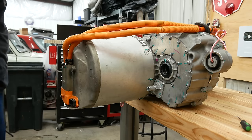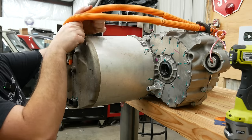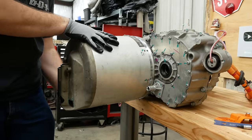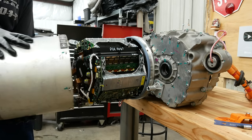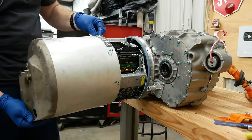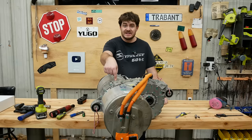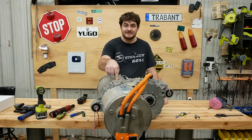No amount of diesel modification is going to get me to these numbers. In the Escape, using the stock Tesla gearing of 9.73:1 straight to the wheels, wheel torque will be 1,600 pound-feet per wheel — 3,200 pound-feet per axle, 6,400 pound-feet total. Now to do the same thing on drive unit two, starting by removing the harness I didn't need to buy. That came out a lot easier than the last one.